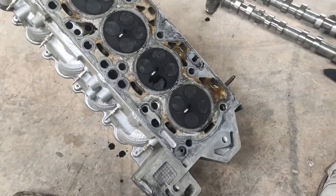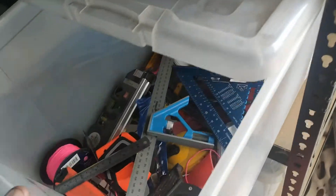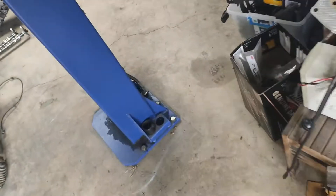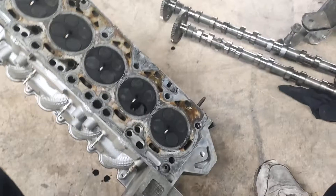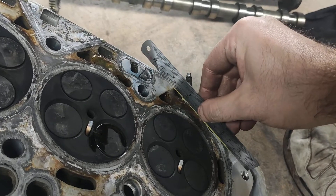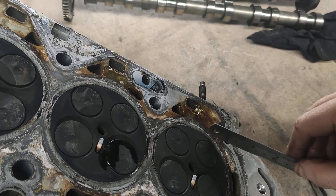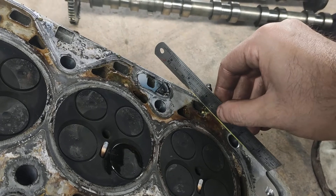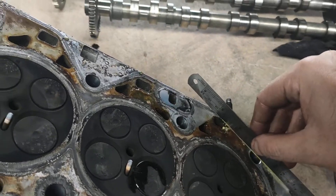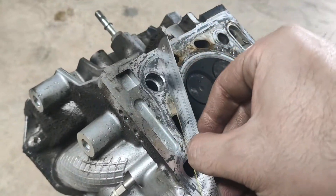One thing I did find interesting - I'm going to need a ruler, just a flat edge of some kind. You can feel it; it might not show that well. On the head, right here, there's a huge lump - it sticks right out, massive, very noticeable, only there. The rest of it seems pretty flat. So that head is knackered.